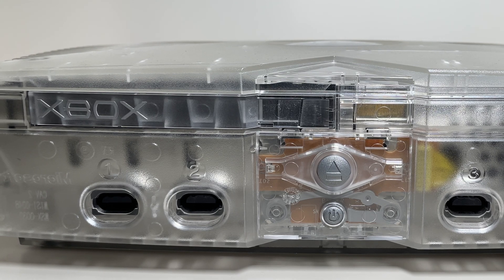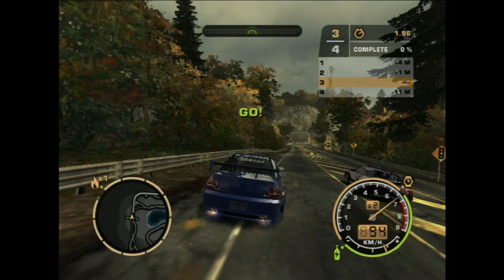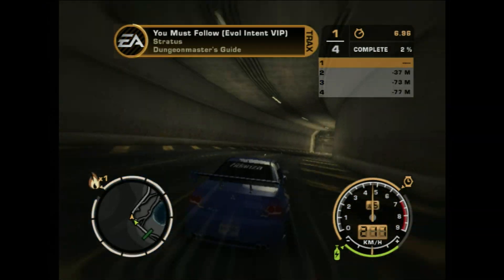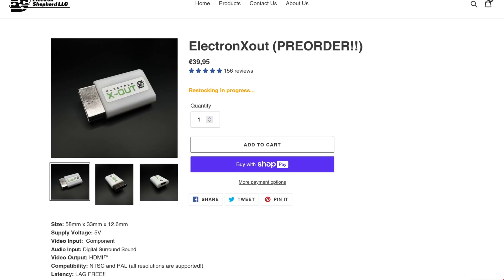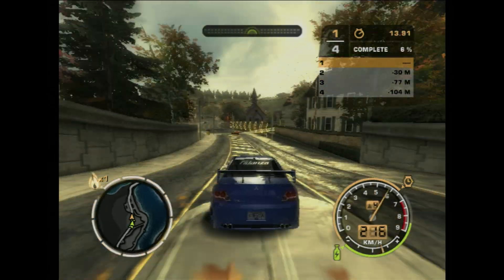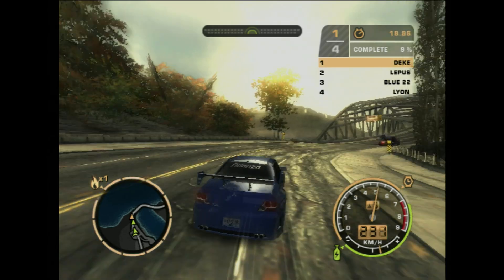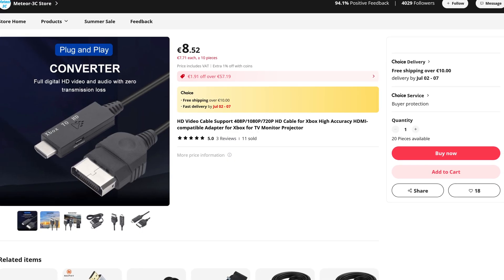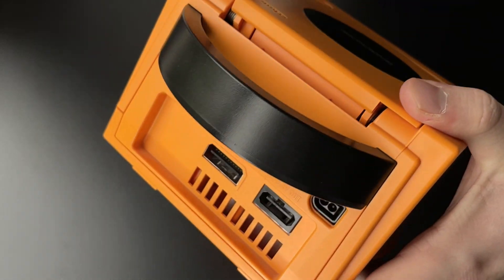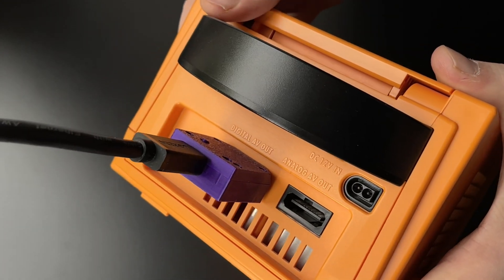There are a few quirks and interesting tidbits to discuss when it comes to optimizing the image output of your Xbox. Before we dive into that, it's important to note that this video won't be covering HDMI adapters or HDMI mods. Still, it is worth mentioning that most HDMI adapters convert Xbox's component output to a digital signal — I say most, because there have been instances where these adapters appear to use composite output instead. Unlike the GameCube, the Xbox does not have a hidden digital output in its AV port.